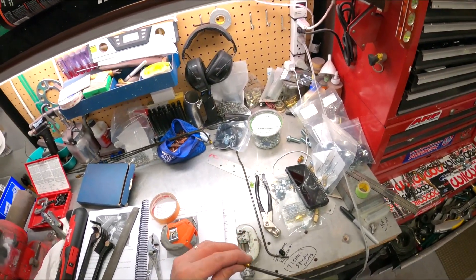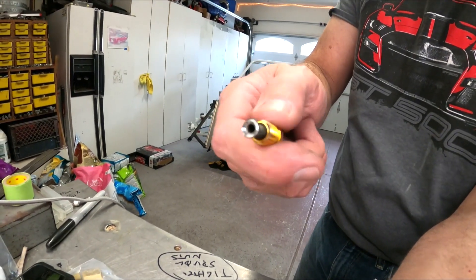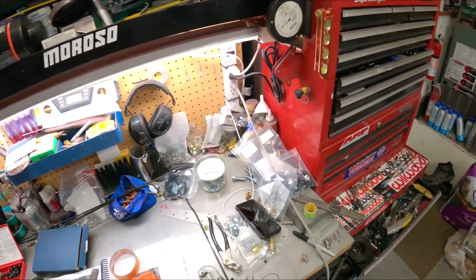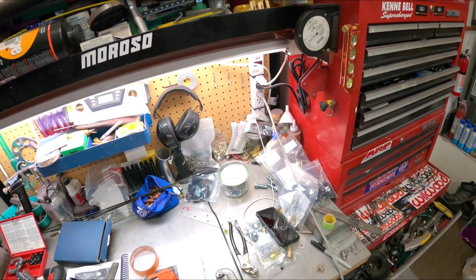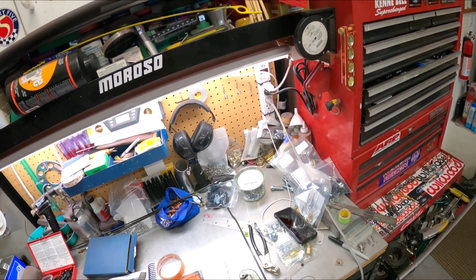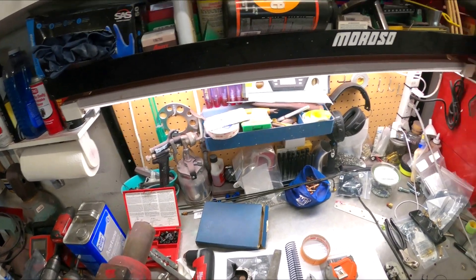So this will come up into here — voila. That's how you do a double flare for brake line. The nut will actually push that up against the receiving end. You can see inside of there it's going to crush it and hold it against that little protrusion — the male part of it — in there. So now I can start figuring out how I'm going to bend this to fit and then flare the other side with another nut on there. Hope you got something out of that — now you know how to put a double flare into a brake line. Thanks for watching, hit subscribe, and we look forward to seeing you on the next episode of the Cobra Daytona build.